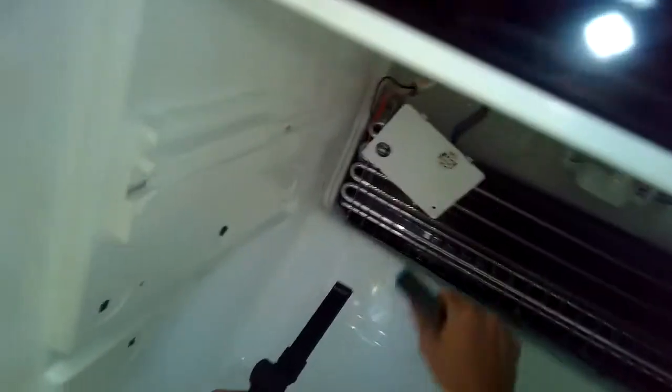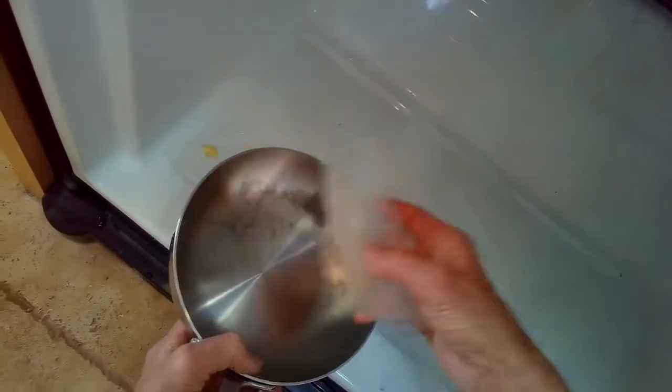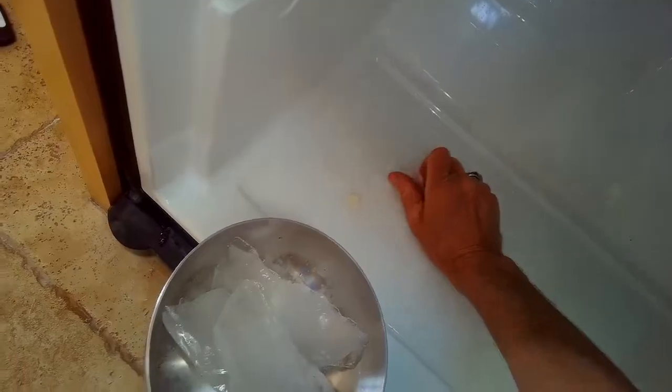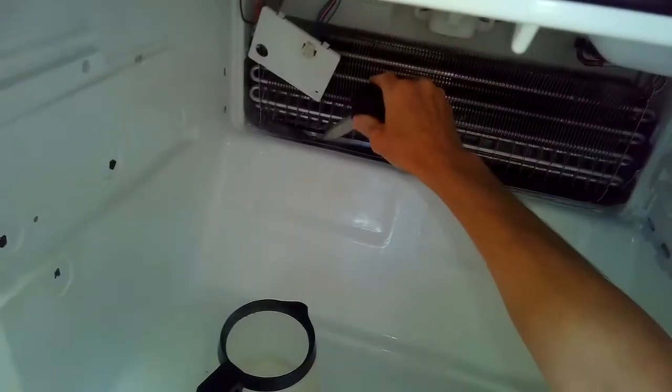Take your time here. Be careful that we don't hit the silver part above it — the evaporator. I'm pulling out the big chunks of ice. In the meantime I've been heating some water to the boiling point — I want the water to be super hot — to use that to melt the ice inside the little hole.